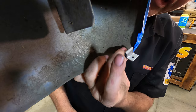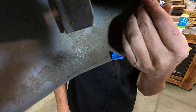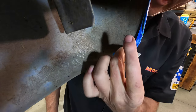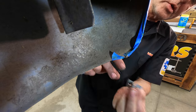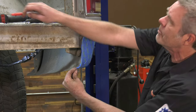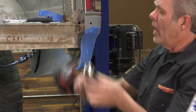It's going to sit in there just like that and I want this down pretty far to the end — we don't want to stick it up high, we want good support at the bottom. I'll set this down here, get a good feel for where I want it, where it's going to be in the middle, transfer this to the bottom, mark it, punch it, and then drill the hole out.